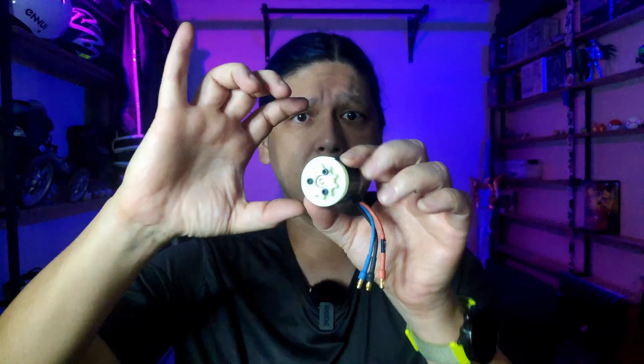All the electric skateboards use a motor around 64 millimeters diameter and around 50 to 60 millimeters height — huge compared to this one. They mostly use a belt drive, direct drive, or hub drive. This one actually worked, but the main problem with belt drives on electric inline skates is if you turn them off or try to skate on your own, the drive system holds you back so much it feels like there's a brake applied. So it's not the best feeling — scratch this.